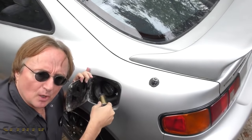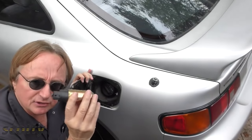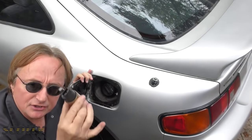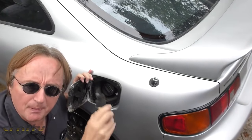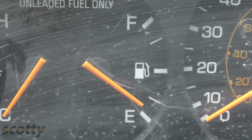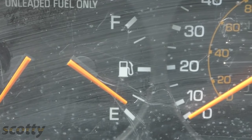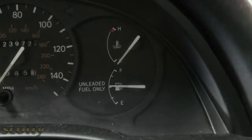As nutty as it sounds, if you're out of gas the car is going to die, and here's the reason you want to check that first. In almost all modern cars the fuel pump is inside the gas tank — gasoline actually lubricates the fuel pump passing through it so the bearings don't burn out. So if you ran out of gas and you keep cranking the engine, the fuel pump will suck air and burn the bearings out. Some of these fuel pump assemblies can cost over a thousand bucks to replace, so if you are out of gas don't keep trying to start the car. Get some more gas, fill it up, and go on your way.